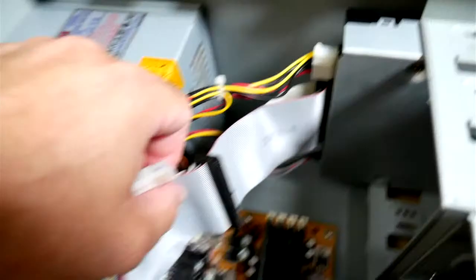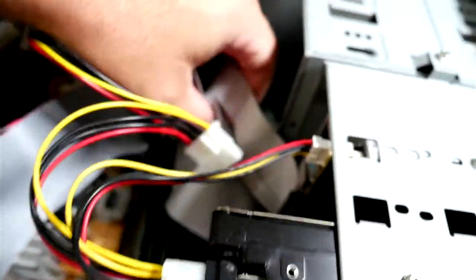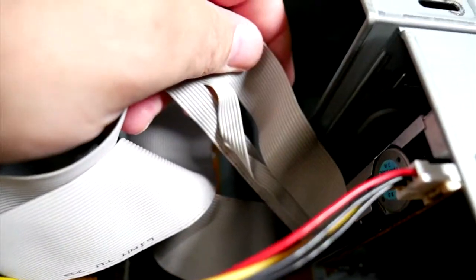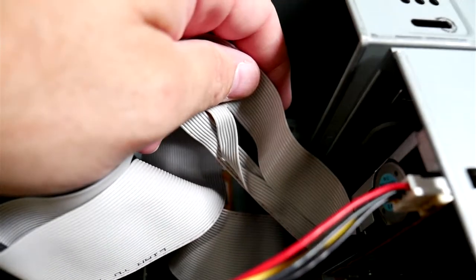Yeah, you see a lot more SCSI on Macs, but a lot of PCs used IDE, and that's what we're going to go with. Oh look, a floppy cable. So relics might remember the floppy cable and how the connector for the A drive had a twist in the cable right there. That twist is what tells it that it's the A drive instead of the B drive.